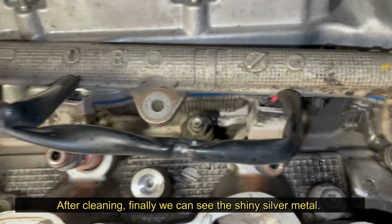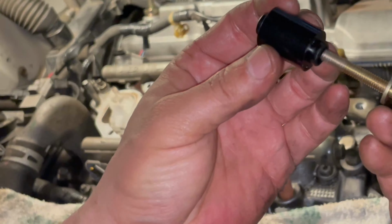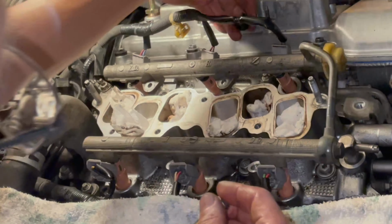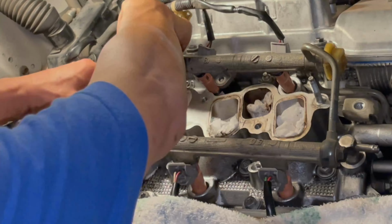Once you have the fuel injectors snapped back into the fuel rail, next, we have to get the outlet side of the fuel injectors placed into the engine block. Okay, line up the injectors. Now you're gonna put a spacer and a washer. So, spacer will go on the bottom. Actually, let me get all the spacers in there first.